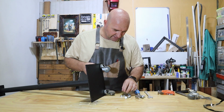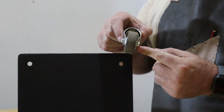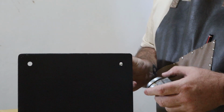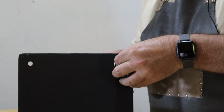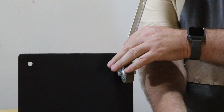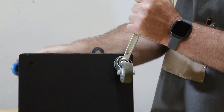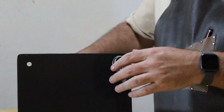which is quite an interesting task. The interesting challenge is that I think the best way to do this is you're supposed to take this bolt out and take the wheel out so you can get access to this side. But honestly, I just don't have the patience to do it. So I can put the nut in here, hand tighten it. I put the lock nut on the top side, and then if I wangle this spanner in here, it gives me just enough grip so that I can tighten it from the other side. But if I tighten too much, then the spanner slips because the nut is not fully in it, but for this case, I can wangle it out, and then done.